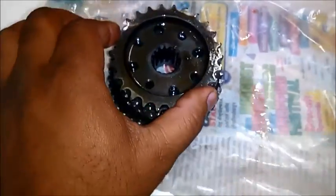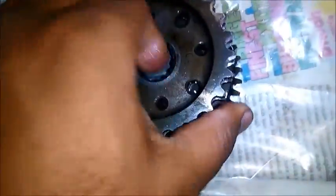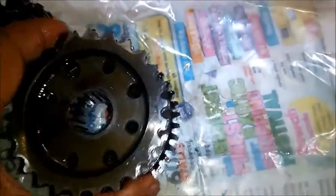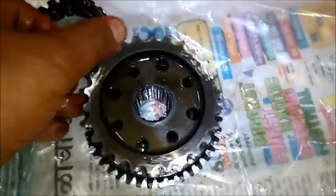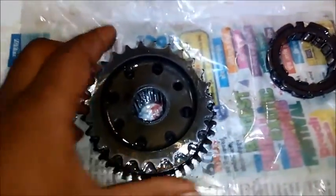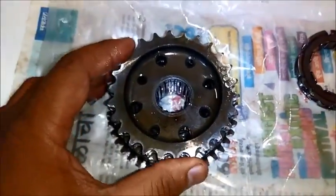Right now this unit is rotating only one side, but that does not necessarily mean the clutch is in good condition. When we tested the bike, we found the sprag was gone because it was rotating both sides. Sometimes it rotated one side and sometimes not — when it rotated one side the bike used to start, but when the bearing was not gripping the surface properly it rotated both ways. If the unit rotates both sides, your sprag is gone; if only one side, it is not — but always check when the unit is not fitted in the bike.